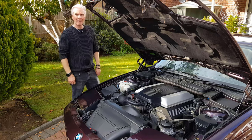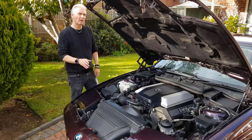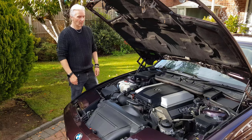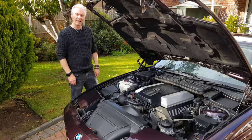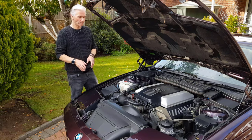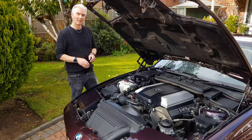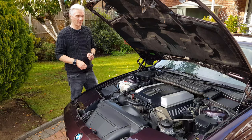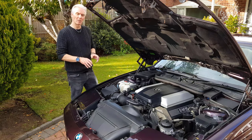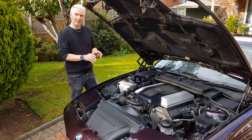Well, we're back home again now. Shall we have a look at the stuff that makes the power out of this engine? Let's start with the cold air intake. The plan with the cold air intake is to get the air coming into the car as cold as possible, because the colder the air is the denser it is and the more oxygen it contains. So the plan is get cold air into the engine using a filter that doesn't constrict the flow.